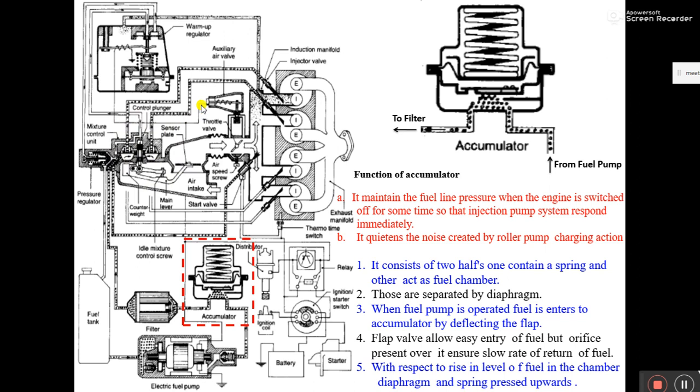So in that way, the accumulator behaves during short run time: whatever fuel is on the line after the filter, when it comes back, it is closed and kept within the accumulator. This prevents the electric fuel pump from taking extra effort, avoiding extra load on the line. This is the work of the accumulator. I hope you have understood the construction and working of this accumulator — why it does what it does. If you have any doubt about this construction, please ask me. Thank you.